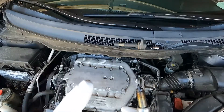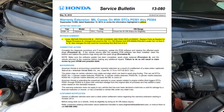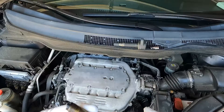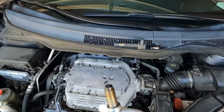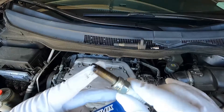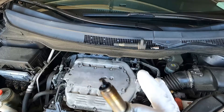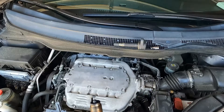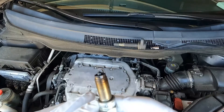There is a TSB for this — I'll put it on screen and also put a link in the description. The TSB unfortunately covers older Hondas with this exact same engine and issue. That technical service bulletin basically says that the rings allow oil to seep past and foul the spark plugs, causing a misfire. Let's put in a new spark plug and see if that at least gets rid of the misfire so they can drive this. I'll talk to the owner and let him know what he can look into with Honda.